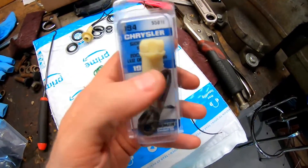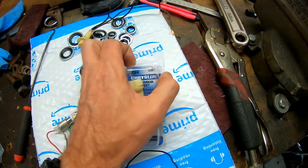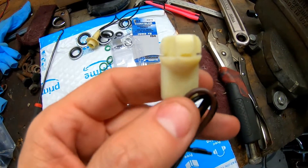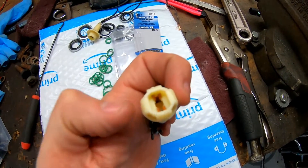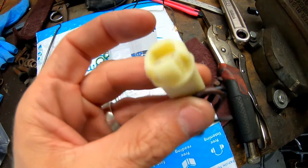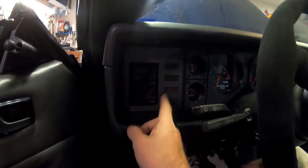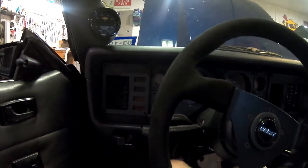Alright, this is the one I've got. I know it's going to be a little bit too big — it's a Chrysler socket. But what I think I can do is use the locking ears on each side and cut the rubber down. This is four bucks, I don't really care. I'll try to make this work, cut it down and see what happens. So it is wired up in the shift light and it should work. Everything is tucked back up into the kickboard where it belongs. I'm going to start it up — I still have the shift point set to 2500, so let's give it a shot.